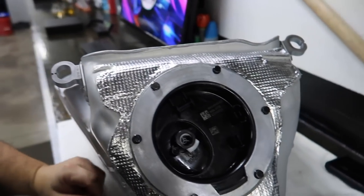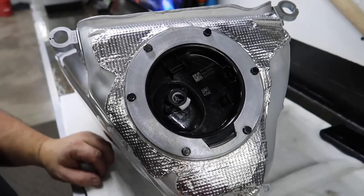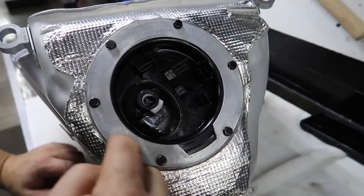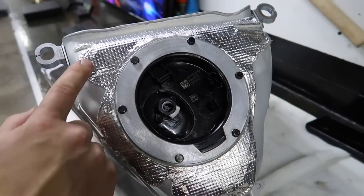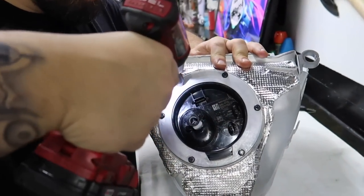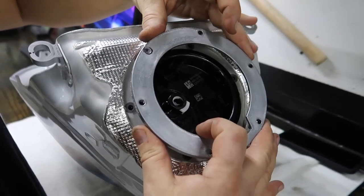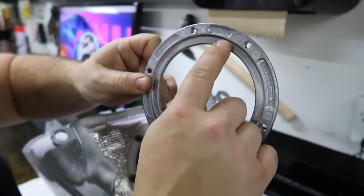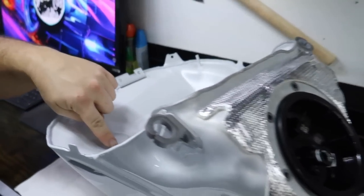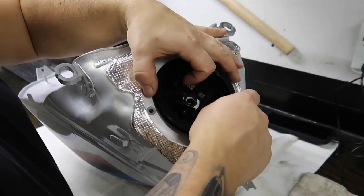We took all the clips off and the rubber grommets. Since we're not swapping the fuel cap over, we're leaving it — sending it to Manny. These are eight-millimeter bolts we need to get out to get the plastic fuel pump assembly out. I believe the heat shielding came with the new fuel tank — I set it right here. By the way, the fuel tank has 77 on the bottom, and I was born February 7th — I turn 40 next month, guys!